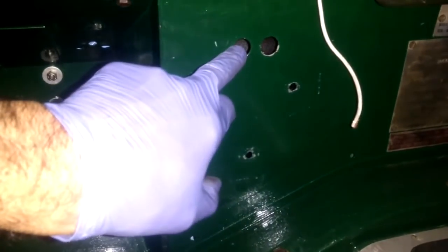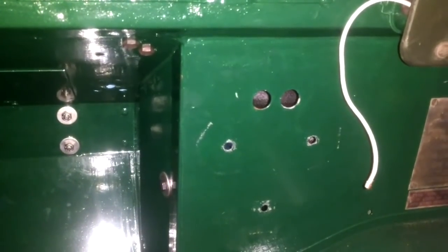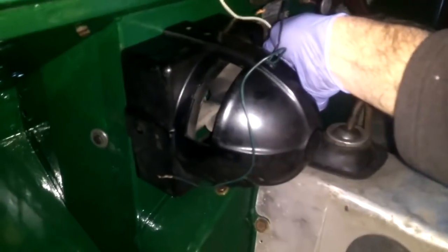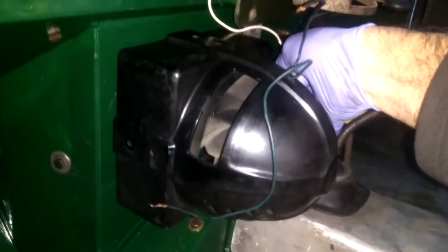This is the original position of the Smiths heater — you can see the three mounting points and the two inlet and outlet holes for the heater core. I'll be replicating some brackets to fit the beehive mounting brackets and modifying the core as well. With the core that sits inside this square cavity here, it's actually almost a perfect fit. If I fit it up there, that might actually work — it'll be sticking out a bit because that's how they sit, but that looks very doable to me.